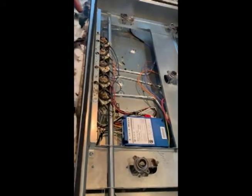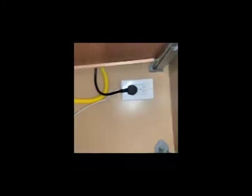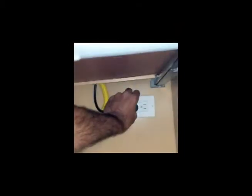We also have to switch off the power supply to this unit. Locate the power supply — in my case it is at the bottom. I have this power supply to the cooktop and I'll just switch it off. Now we're ready to change the igniter.